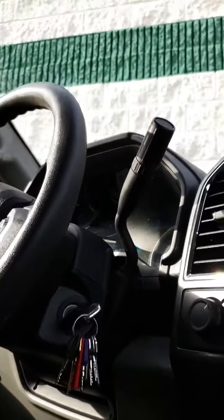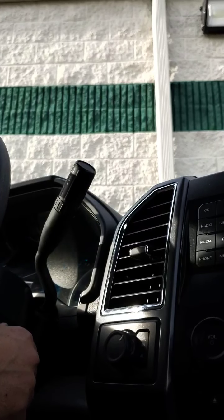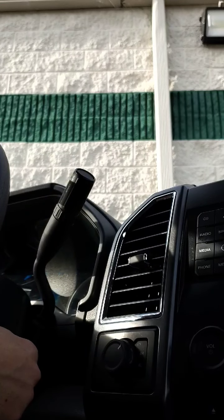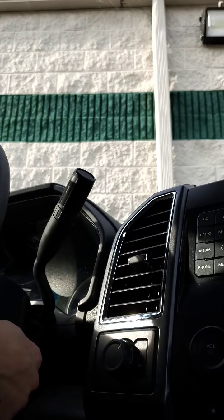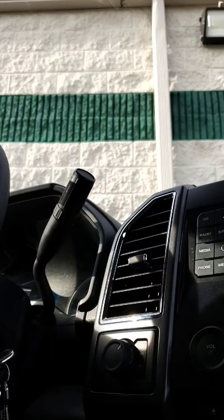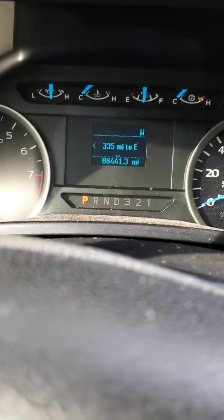So see if I can get you guys a good view here. Probably not, but so the key's on, accelerator down, parking brake up, down, key off, key back on. Okay, parking brake's engaged. Start the truck. I'm gonna pump up the brakes. Feel like I got a good pedal. No more maintenance mode. It's off.